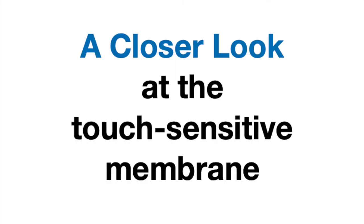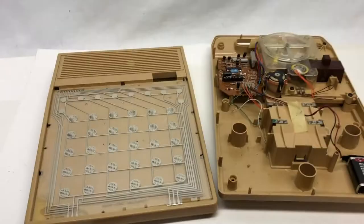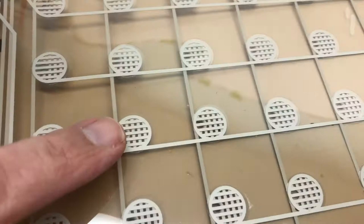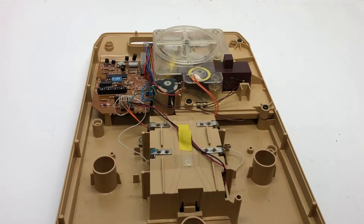I want to remove this to more easily test things. Each one of these tabs I'm pushing in with a screwdriver, and it's starting to come out. I was able to pop off the screen in one piece. Here's that membrane - these are the buttons. The clear card is bent in half but seems to be glued together - you can barely make out a fold. When you push, you basically complete the switch by pushing the top part of the button and making it connect with the bottom part. So what you've got here is really just a smart record player.